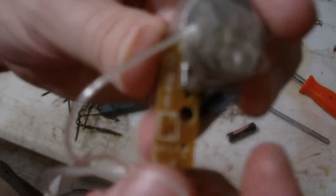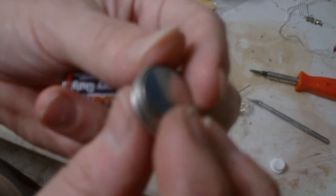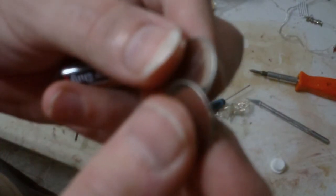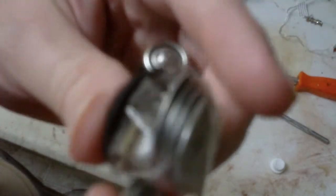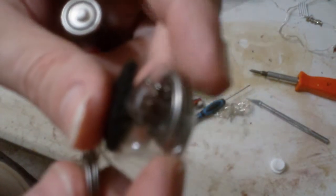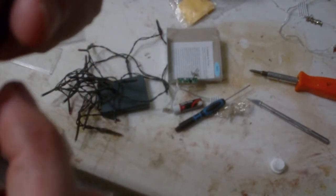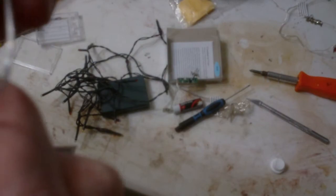What you need is to replace the AAA batteries with three-volt coin batteries — you get about four of them. You stack the four up with a little bit of tape, and you tape them to the battery connector. The back is positive, and that other side is negative. Once you do that, you connect it up and it's on.